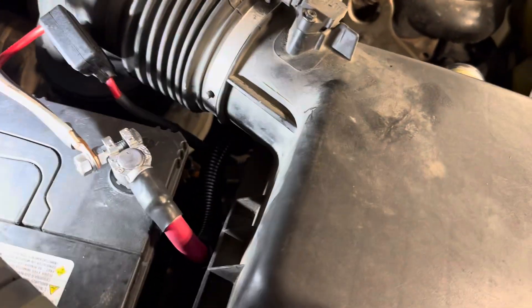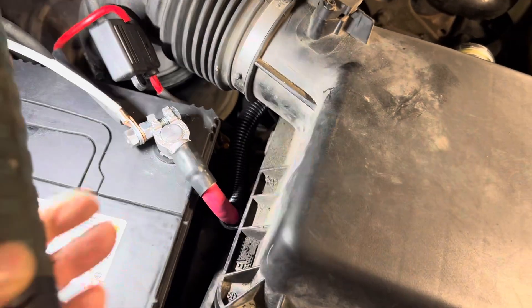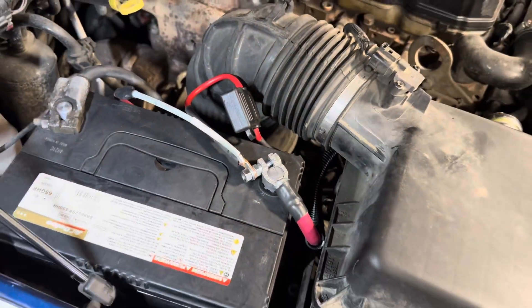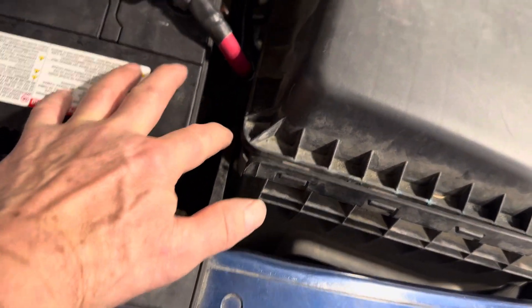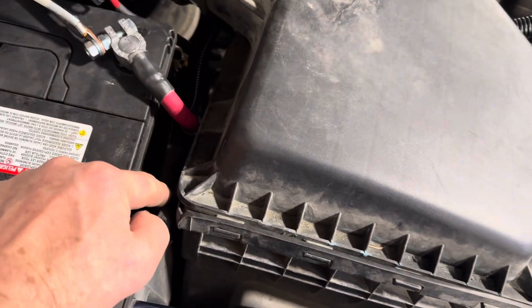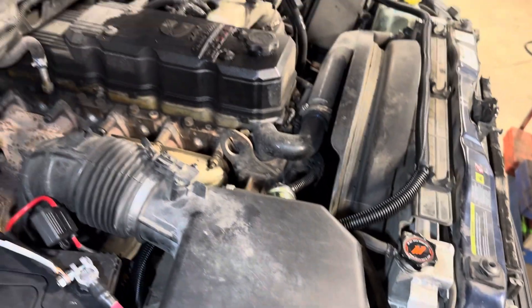I did put a traditional 60-amp fuse link to the alternator — I had to make this wire because it's discontinued. I was able to get the positive battery lead, which comes with the fuse link that powers the solenoid. My grounds look good, and I'm having to order the battery trays. Both of them are busted out and do not secure the batteries — they rattle around. Initially, this is where the fuse link passed through and got pounded on by a loose battery, and I believe it shorted against some ground there. That's how it started.